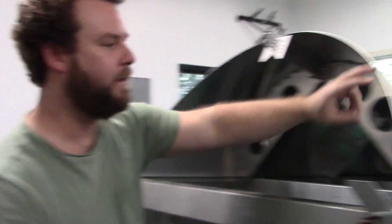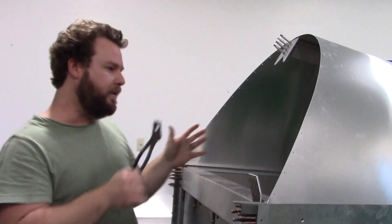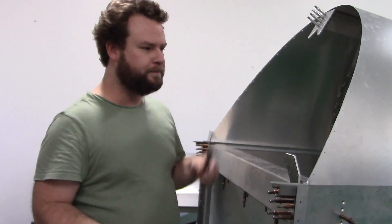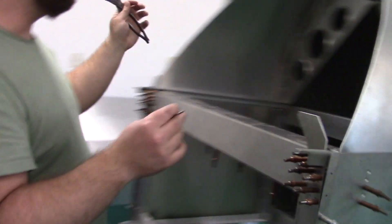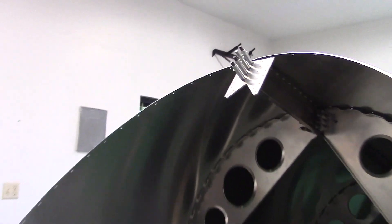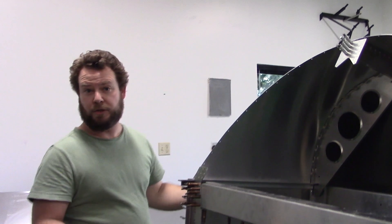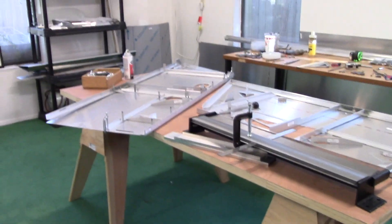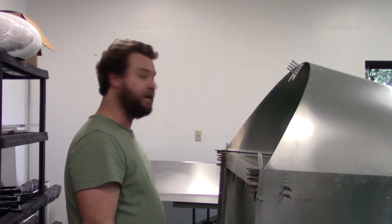Once I get this side drilled in I'll measure everything up and make sure it's square, and then you're allowed to drill in the left side — otherwise you could put in the ribs a little off-square and the airplane can fly a little askew. You want it to fly as straight as possible because you never know what other problems you can have. So that's in now — I'm very excited. I also put this clip in up here that I hadn't done yet, and I'm getting to the point where I can finalize these pieces, drill it off, and be completed on this section. Once this is done I'll start working back on the sides of the airplane, then put the floor on and the wing box where the wing connects, and eventually be able to sit in it — so that would be fun. Thanks for watching!